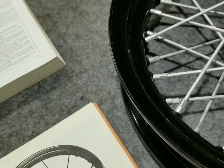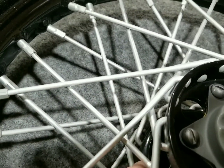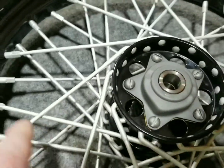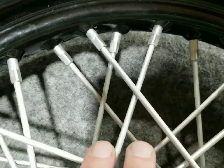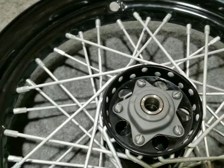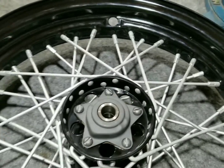When you flip it over to start the star side, the inner set goes the same way as the other side's inner set. The inner set on this side is going clockwise and the inner set on the other side is going clockwise, and the outer set is going counterclockwise. With this 40-spoke pattern you should have two X's that all look the same as you come around - otherwise you've got it messed up somehow. It's all turned out pretty good here, so we'll go on to truing the wheel.